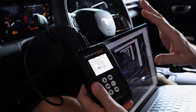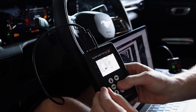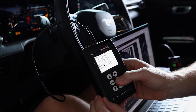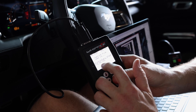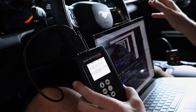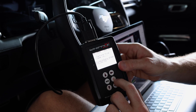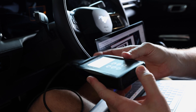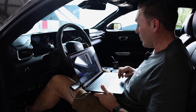I just made a dyno pull and I've got a log saved on my computer that I'm going to show you. The most important thing is that you hit Star to stop the data log, then hit Star again to save the data log. Your unique identifier number will show. Then you can turn the car off — but do not turn the car off until you've pressed Star then Escape twice. From there, pull the SD card out and put it into your laptop.